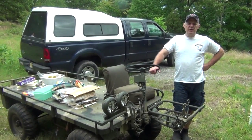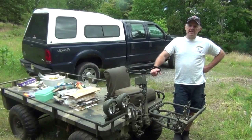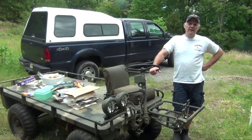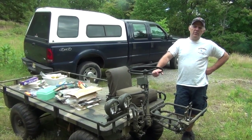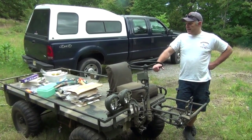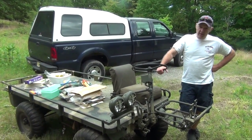The gas tank — we already took a quick peek in the gas tank and the gas is pretty ugly, so we don't want to try to run it. We just want to make sure it has oil in it and then do a quick compression check. Based on that we can be pretty sure it's not in too bad a shape and we can get it running quickly.